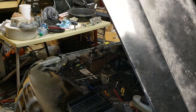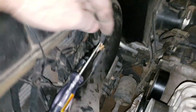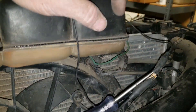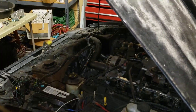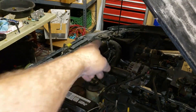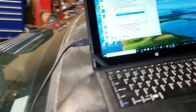I have the fan motor plugged back in. These two wires normally go to a little coil module — it's like a resistor coil that basically drops the voltage through the winding to slow down the fan motor for low speed. That's missing, so I've got a jumper through an alligator clip, which will drop a little bit of voltage since it's not rated wire for the current draw on that motor.